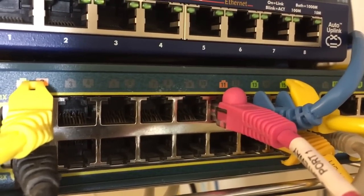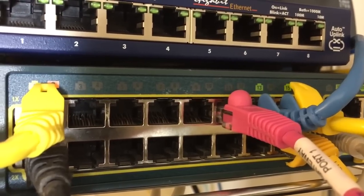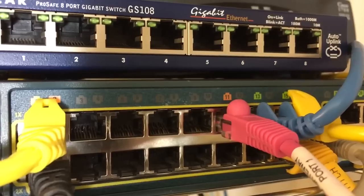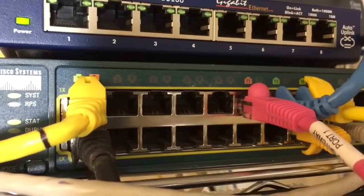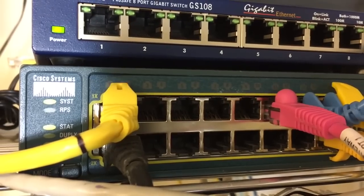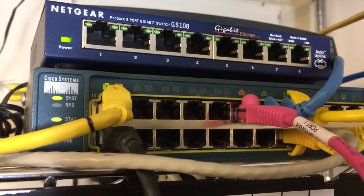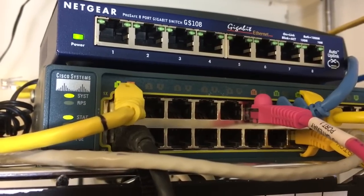You can see there it just turned orange, which actually helps you pick it out of a crowd, and then it goes back off. Normally with a Cisco, when you plug in your network connector it negotiates orange, then when it goes to a 100-megabit connection it turns green — but it's not getting to that point, so it never turns green. What you would do is stare at a block of about 12 ports at a time, and if you don't see anything, move down the switch to the next 12. For installations with three or four switches this isn't too bad, but for really big installations this still may not be your answer.